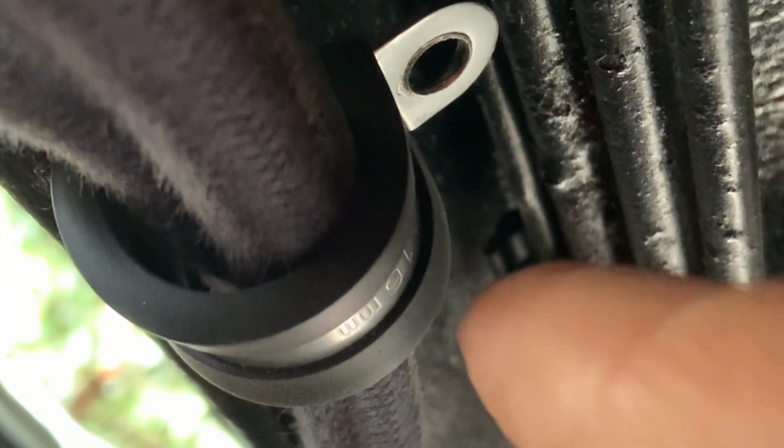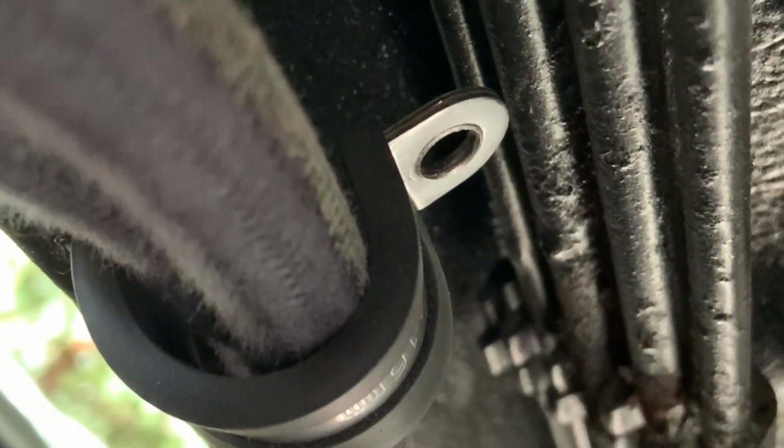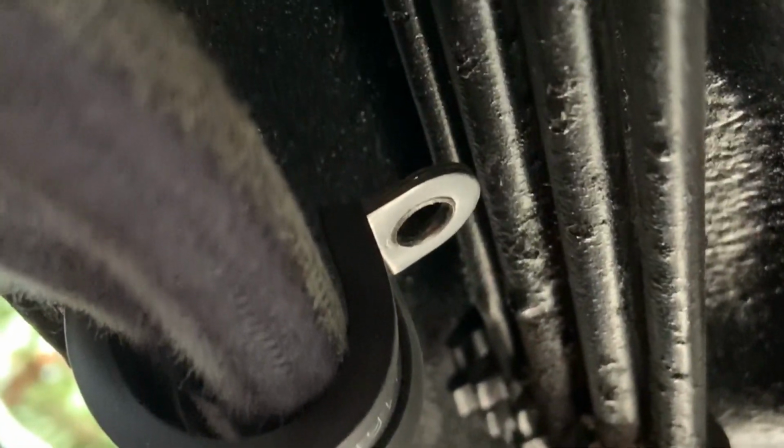What we're going to use is the existing holes and marks to put a couple more in the chassis rail, and then using that rivnut tool that we did for the body panels, we put a rivnut in. And then this isn't the finished product, but what we're going to use is these style clips to hold the line, and then run a few all the way down, and then yeah, I'll show you the bodywork, because well, you can see some of it here, and underneath the tunnel we've tried to go all the way up there.